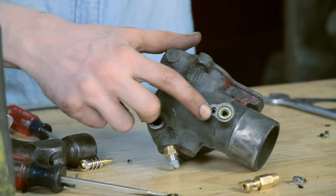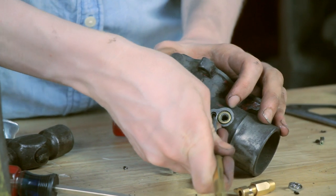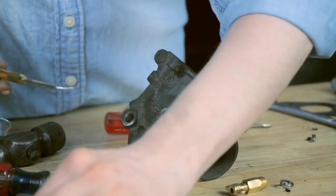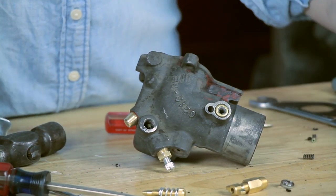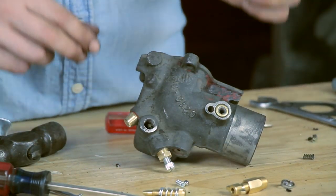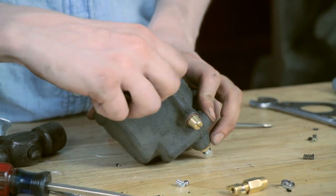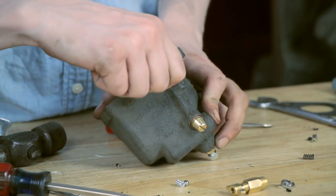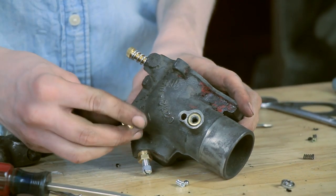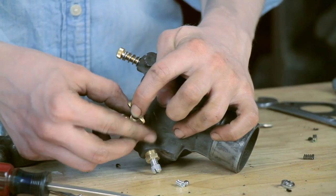Next to the throttle shaft there's a little spring down in there, and I got a new spring in my kit, so I'm going to pull the old one out. There's the spring — and the little ball bearing came out automatically. Here's where the new spring will go, and then I'll have a new ball bearing that drops into place. Over here I'm going to put my idle needle in — I'll screw this down all the way and then come back out one full turn. Lastly, I have this drain to go in the bottom, and I'll tighten this up all the way.